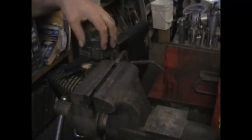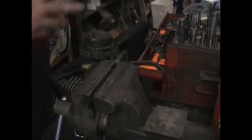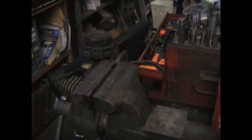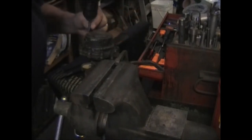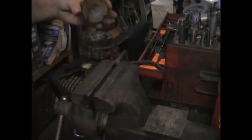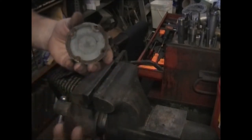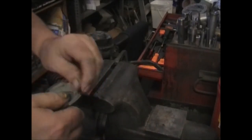Remove these four screws — this is the vacuum side. Remove these four screws and there will be a screen and a gasket underneath it. There's a screen and there are pieces of the gasket. You're not going to use any of that over again. So if you're doing this at home and you have a kit, just match up all the parts.